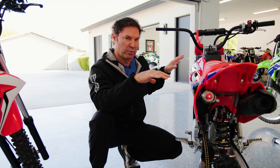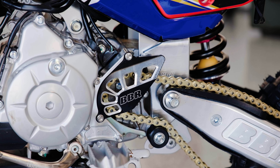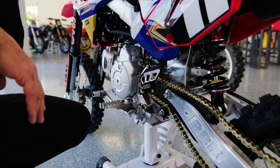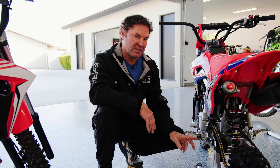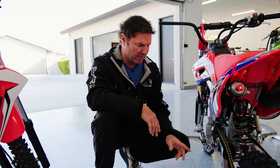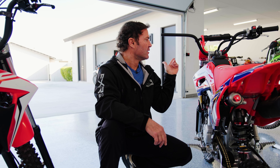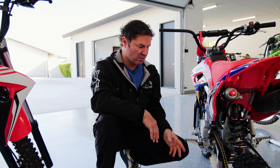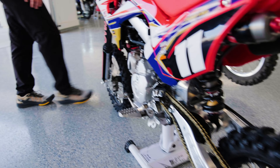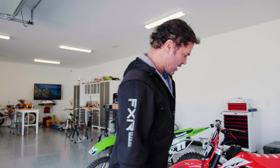I'm doing this particular height because BBR said that's the perfect setup for the pro comp front end — we want it to look right, feel right, and ride right. The geometry looks perfect with how we have this set. You have a really nice case protector and rear chain guide — they just do really nice work. I'm looking to put a kickstand on this; maybe the KLX 140F since it's a taller one. I'll go to the dealership, measure it on the showroom floor, and if this piece is the same as what Kawasaki runs, I'll use that one on this bike.